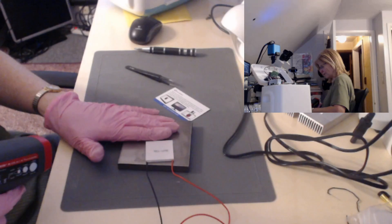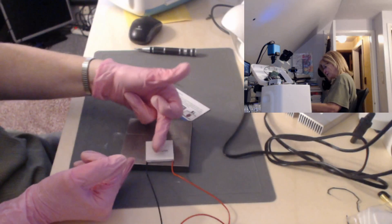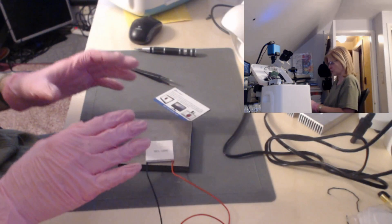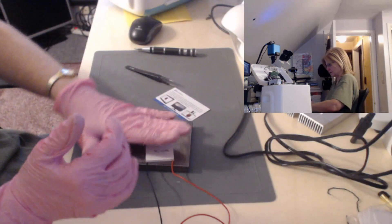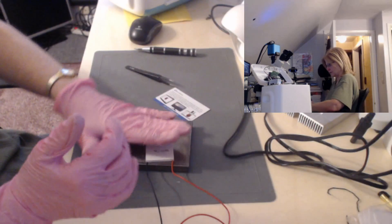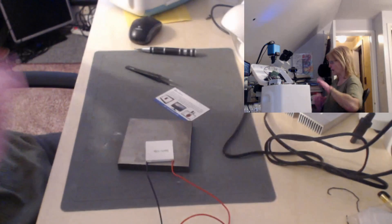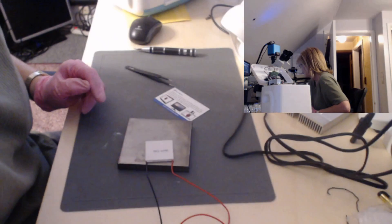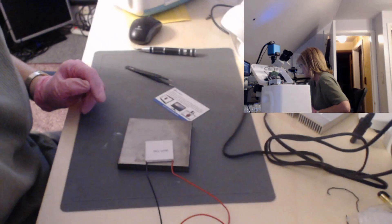The other side is getting warm and it's doing exactly what it's supposed to. We have the copper wires coming in, and between the two ceramic plates we have the 127 pairs of N and P semiconductors — the bismuth material. The current flowing through where they intersect is where we see the temperature change. The cold is on this side and the heat is transferred to the bottom side, absorbed through the heat sink, and the fan blows it away from the unit. The fault in this unit was a bad Peltier module.